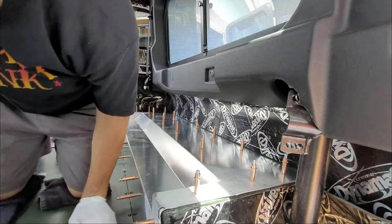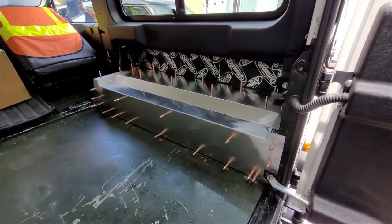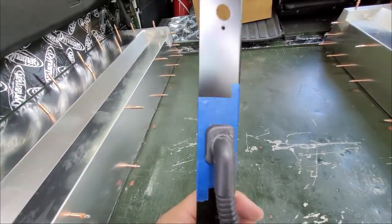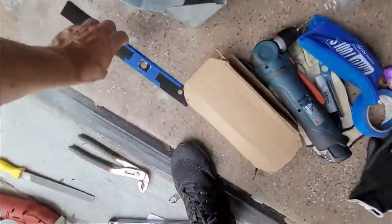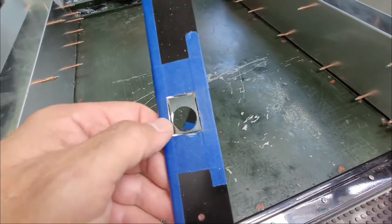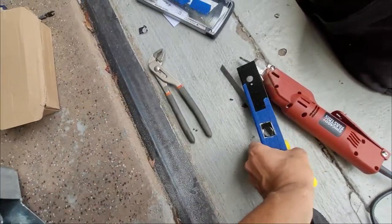I'm only missing one — I'm gonna have to run the drill through it again. These two things are in. Everything's clean. I put in the side trim and while I was at it I went ahead and made these square. I'm gonna have to make the holes up there on the A pillar. I finally made the hole square — it was 27 millimeters long by 19 millimeters wide, and the regular hole is just like that. I put a Dremel cut just enough on both sides and then I'll use this little metal body saw to finish the cuts and then use the file.